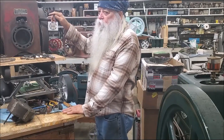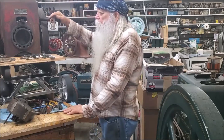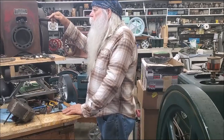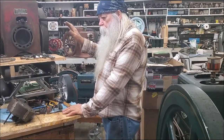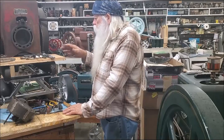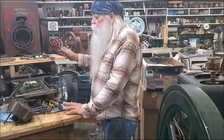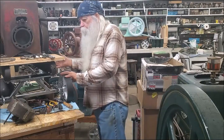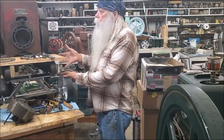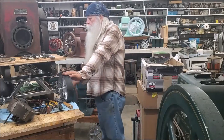Most people won't own up to having one of these engines. They say, 'I don't care for no LB — they're low priced. I'm not going to work on no LB or LA.' That's most people's attitude. Not realizing some of the different parts on this engine that upgrade it from the lower model. The self-contained crankcase is another one — probably environmental, the prior model being the total loss oil system. This one you change the oil and use it over and over periodically.